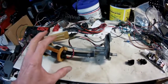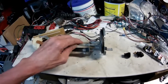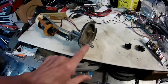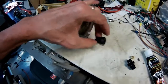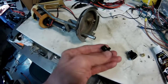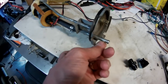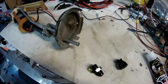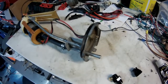One of the projects is my fuel pump mounting bracket — hanger, whatever you want to call it. It's got this 3/8 nipple coming out of it. My plan is to install a 6AN fitting on there. What I'm going to do is cut off the nipple on the end, put a ferrule on it, and the fitting. Then from there I'll go with a 90 and run braided hose over to my hard line.